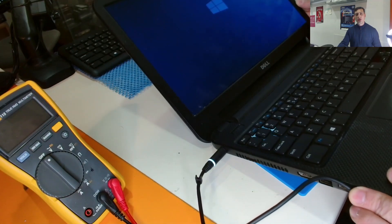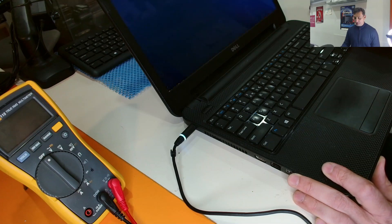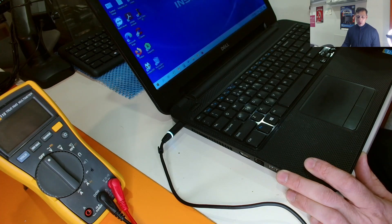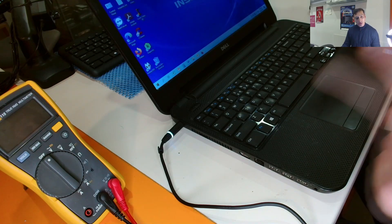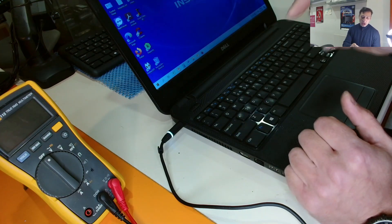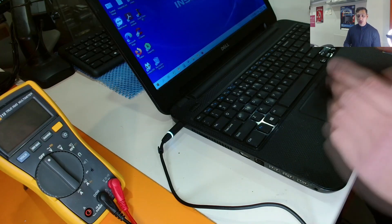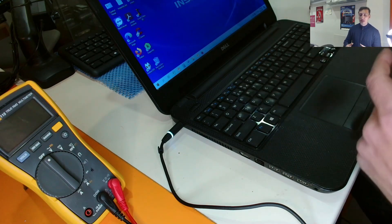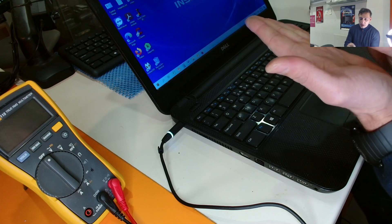So that was the video. Thank you for watching. This was a video that I'm not sure if it's going to be very useful, but it shows some troubleshooting steps you can follow to diagnose a water damage problem. You have to inspect the board thoroughly to see if there is any corrosion or shorted components. Clean with IPA as much as you can and test the main voltages on the PCB. Also have in mind that the frozen BIOS is a really tricky one. Always remove the BIOS battery, short the battery probes to reset the BIOS from the motherboard, and also try switching the memories, resetting the memories, and cleaning the legs of the memories.